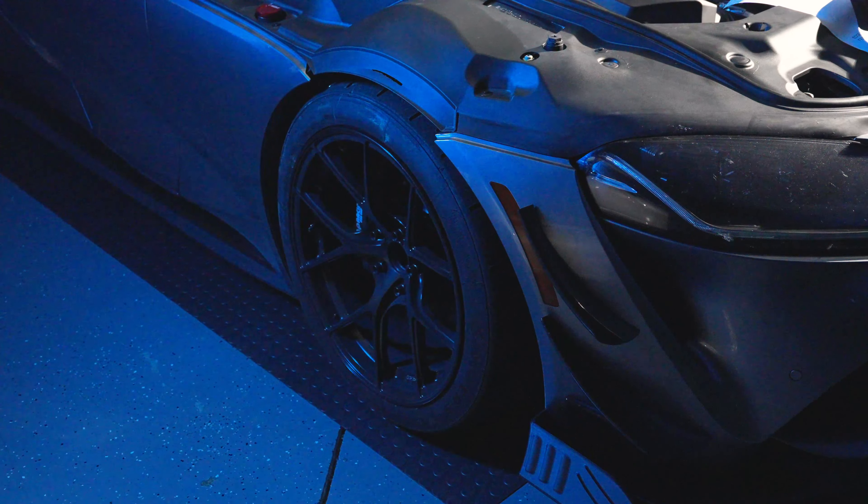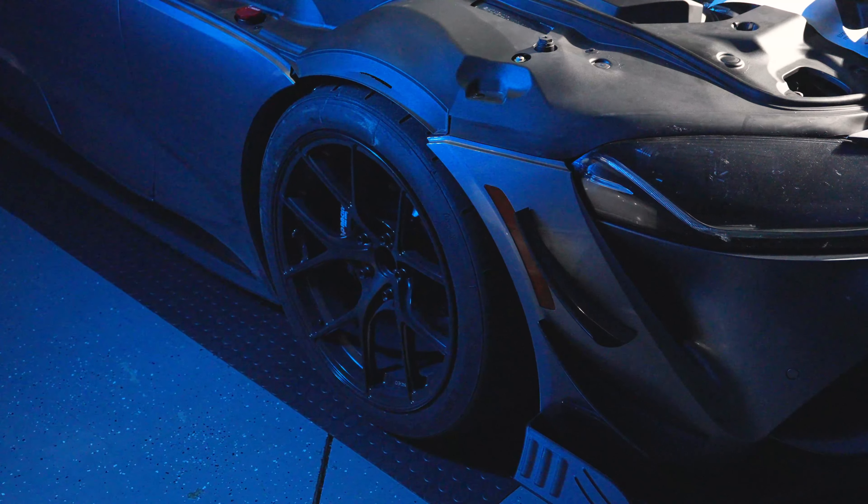One of the common problems on road vehicles like this is a buildup of high pressure underneath the wheel wells. The high pressure pushes up on the underside of the car and creates front end lift. The Supra also has a radiator outlet in front of the front tire, so you've got this high pressure zone and hot air trying to escape from the radiators — it's just not a good combination.